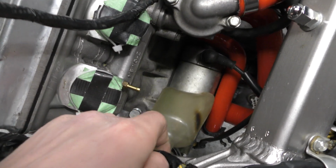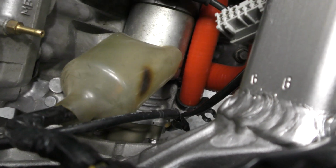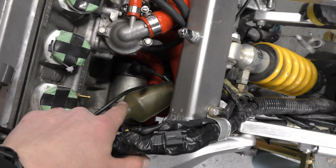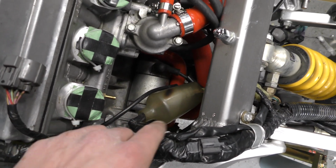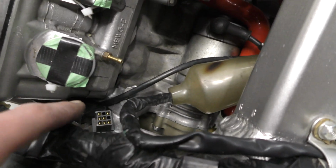These set of plugs are just gonna sit right down there. You've got the big gray clear, and then the kickstand is the green right there. The last part of the harness here were these three connections: the clear from the front of the motor, the green for the kickstand, and then there's a gray from here. Pretty much the gray stayed exactly where it was. The clear from the front, you see, snakes up and over the center motor mount. It stays on the inside of the frame.